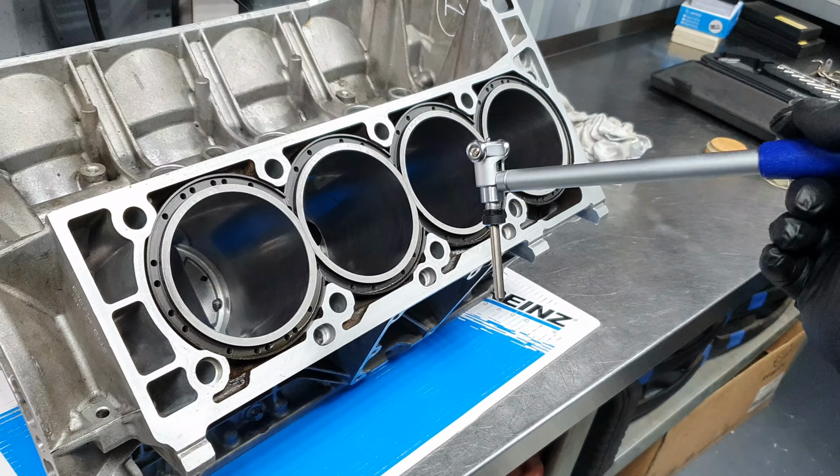If you remove the carbon, the carbon itself is working as an extra material between the piston and the cylinder wall. So on a cylinder that has so much runout, by removing it and putting a new piston, or cleaning the carbon off the old pistons and putting them back again, you're not going to have a happy end. You didn't do anything. With this amount of runout, the piston rings are going to end up all in one position.